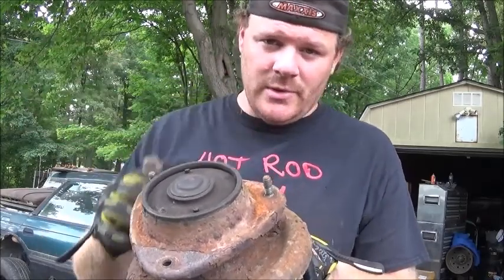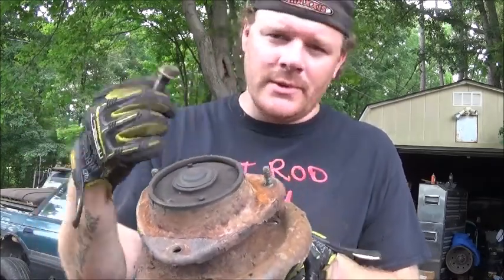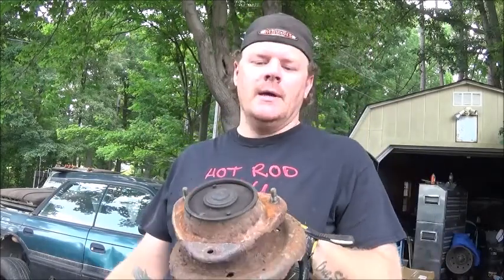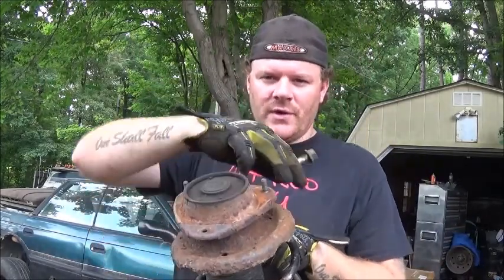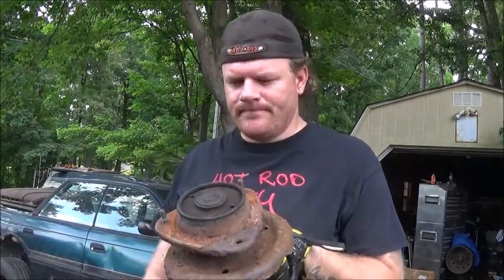When you buy a pickup truck, the rear is jacked up a little bit to compensate for loading it. A lot of people who buy trucks but don't actually use them for hauling put low levelers on the front to bring the front up to match. So I can make a quick one of these — doing the plates like we did on the rear, it's going to be two and a half inches. I can quickly make a two and a half inch one with a little bit of plate and a couple pieces of tubing. I'm going to go ahead and run out and grab that stuff.